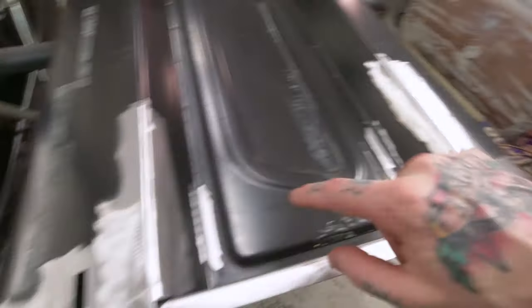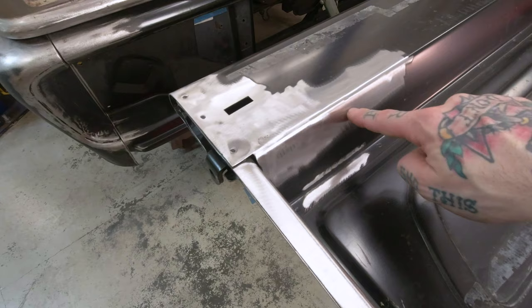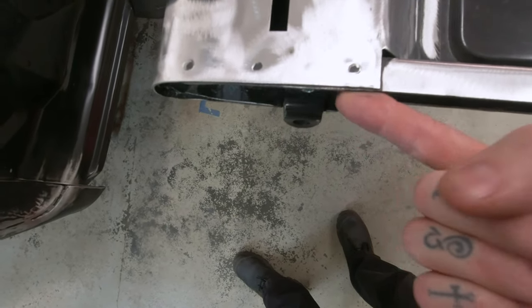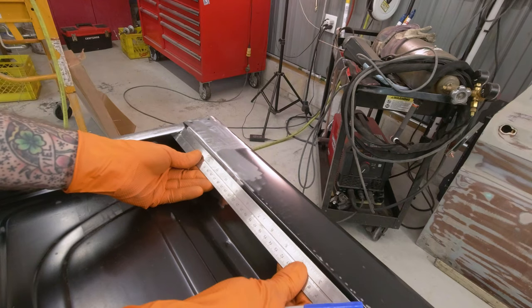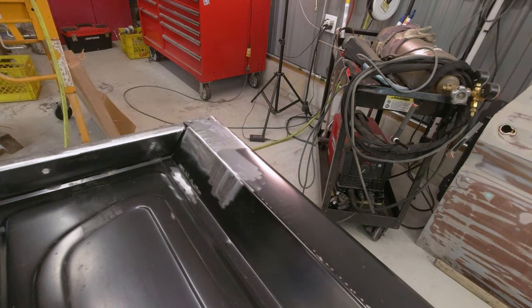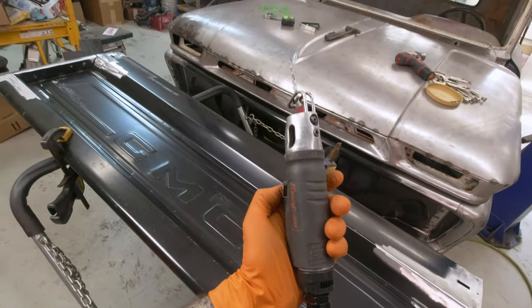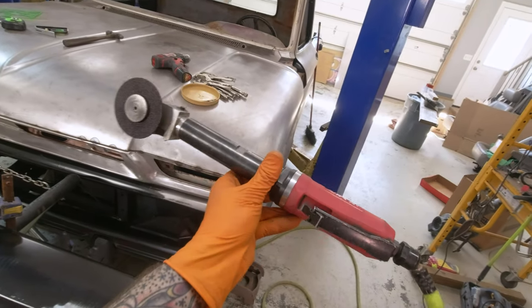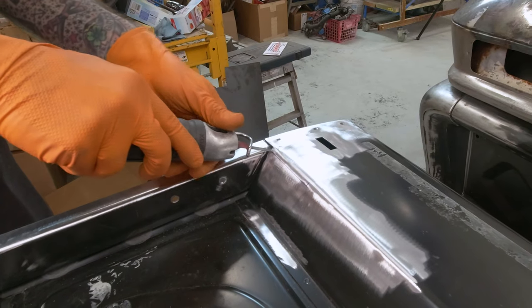I think we're going to be okay with it being how it is if I clean these ends up. Part of cleaning these ends up is that little extra length from the taper down of these panels. I'm not liking that and I want to go ahead and taper them down to get them a little more flush to the tailgate itself, which will then get them a little more flush to the body. I'm actually going to cut on this raised panel section here — a straight line — so that this whole area can taper down to meet here a little bit better. Also this piece has another overhanging flange area like what I had on the back side, so I need to trim that so that it's flush to the outer skin. One of the hardest parts about what I'm about to do is the fact that I cannot get to the inner structure of these things at all, so I'm going to make shorter cuts — probably more like three inch cuts rather than six inch — because I can't access inside to hammer and dolly.